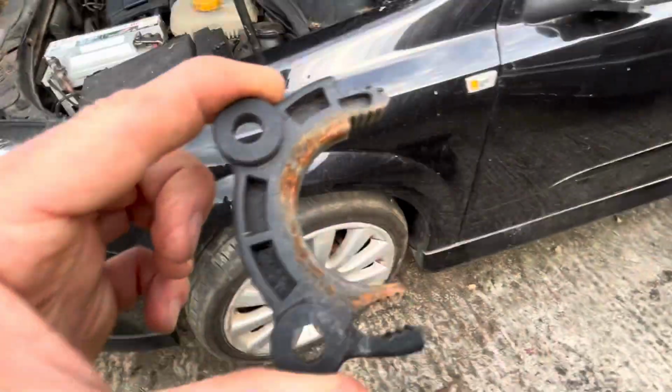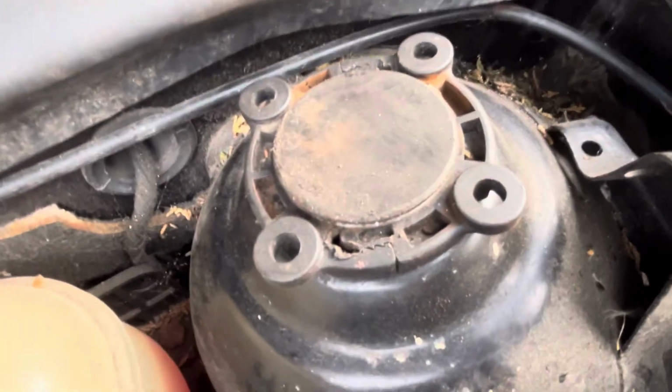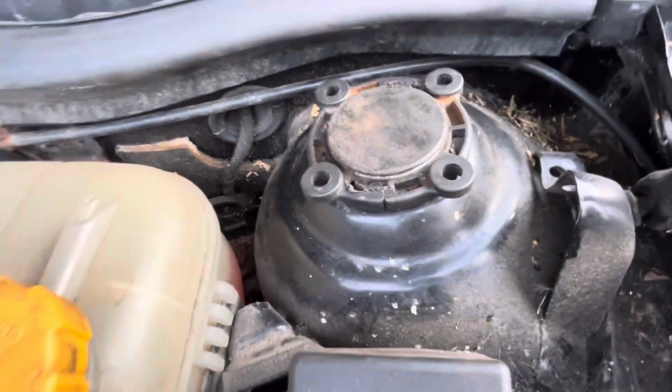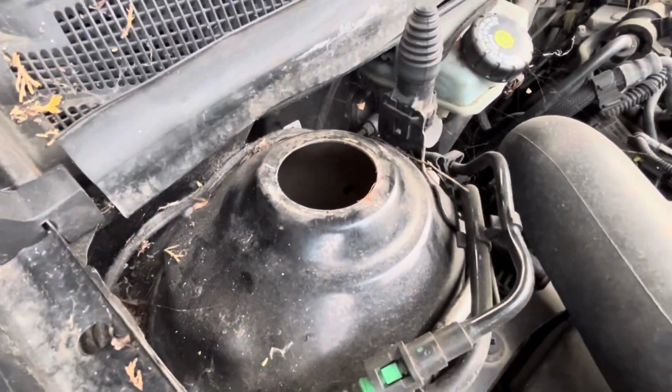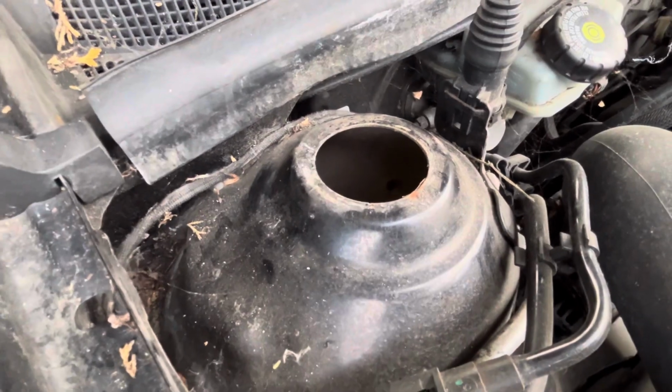It's just like a little ratchet, as you can see, showing the side that's reattached, and you just push them together and they just lock with them little teeth, and that's it. That's all that holds the shock in. So when you jack the car up off the ground and the wheel's dangling, it's just them little plastic clips which are stopping it from pinging out.